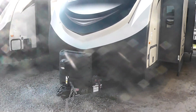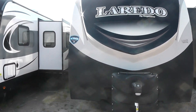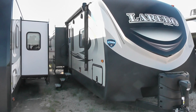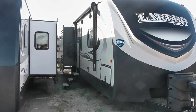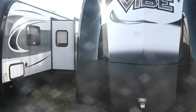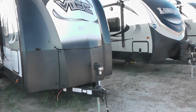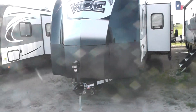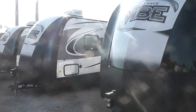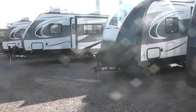The next is a bumper pull Laredo. The difference between the Laredo and the Vibe is not the construction necessarily — the Laredo tends to be a lot more aesthetic. It's got finer woodwork, better material on the couches, that sort of thing; it's a prettier unit. On the next video I send you, I've picked out a Vibe I think you'll be interested in. They're about the same size, and all these units we're talking about today with the aluminum and fiberglass siding are going to have 50 amp service with two ACs — one 13,500 BTU and the other 15,000 BTU, so that's about 2.4 tons of AC.